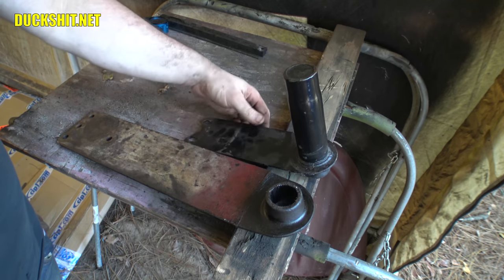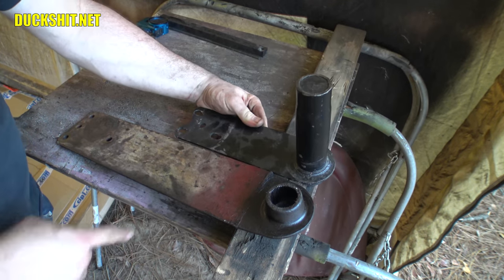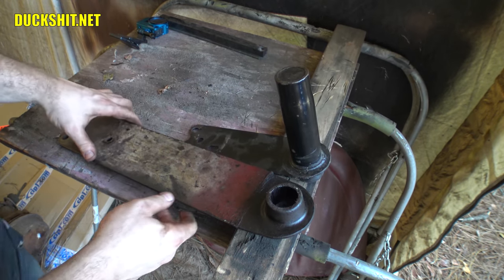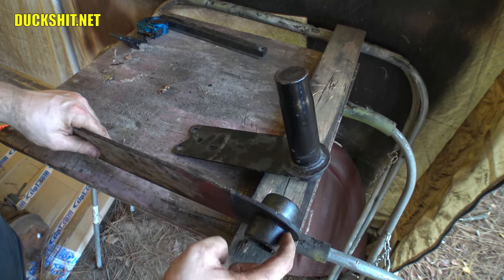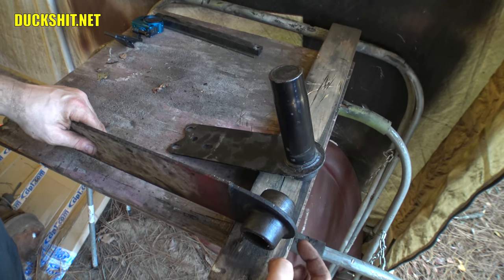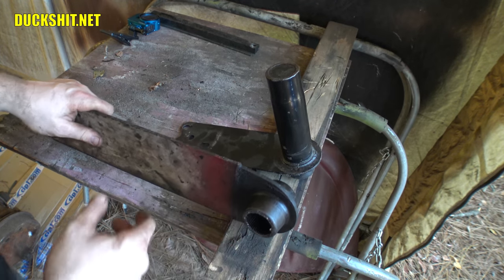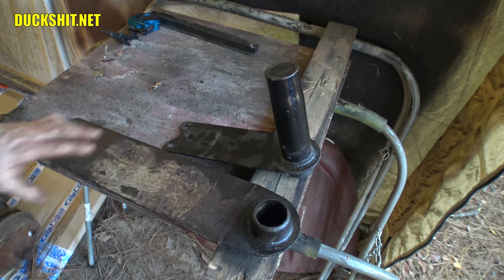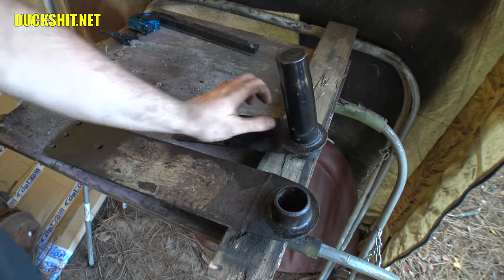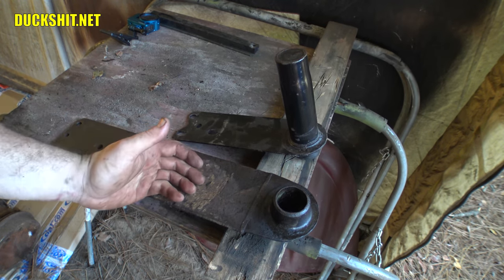What I need to do is turn this spring plate into this one. I have to get these lined up, cut it off, cut out the slots, and then because I'm narrowing the rear end I'll probably have to cut this out and reposition it about an inch and a half in one direction. That is yet to be determined - I don't know how far I'm going to go yet. I can't finalize everything until I have a brand new set of torsion bars because the ones that were on there were obviously crap.